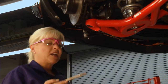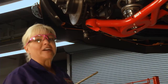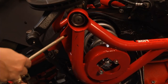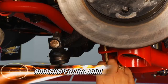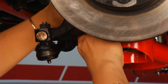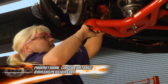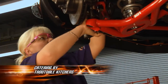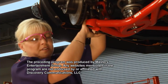Now that Tommy has everything buttoned up in the back, we're going to do the same here in the front with our BMR suspension and our front sway bar. This thing is a lot bigger — inch and a quarter solid, with solid mounting, polyurethane mounts, and our end links. This thing has been cold-formed, so it's going to resist torsional fatigue and help it retain memory. We're going to get this buttoned up because we've got a lot of things to tighten, torque, and adjust. But man, this Camaro is going to ride so much nicer and have a great feel to it.